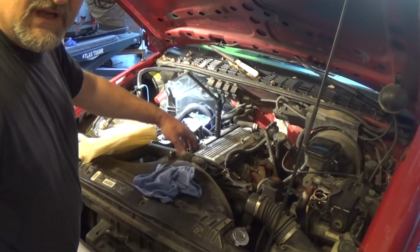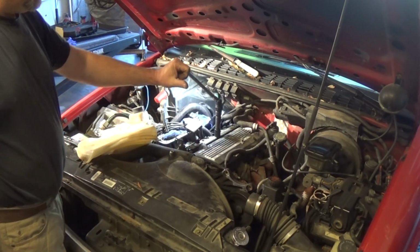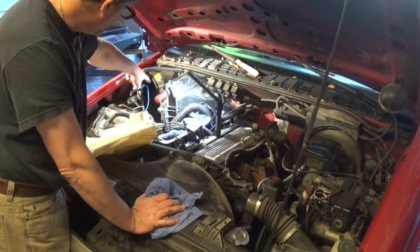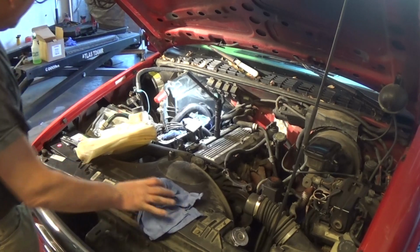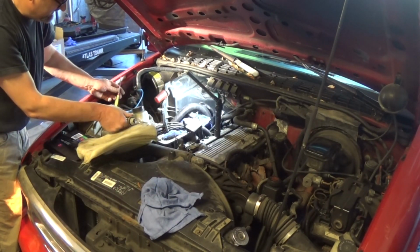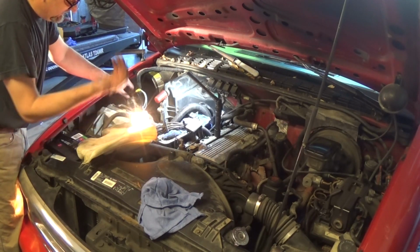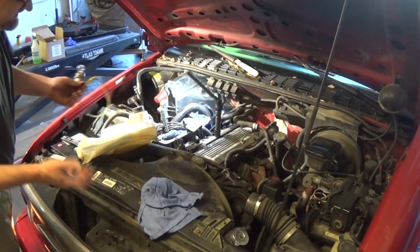All right. Along with the injector, we have another complaint that the blower motor doesn't work. On any speed, when you turn the knob inside the cabin, nothing happens. And I honestly didn't even realize that the fan is located right here underneath the hood. I got a harness disconnected, and I have my headlight here. And as I said, now I have my knob all the way up to high speed. As you can see, the light bulb is lighting up. And so this is not enough, because this light bulb is not going to pull as many amps as the fan.